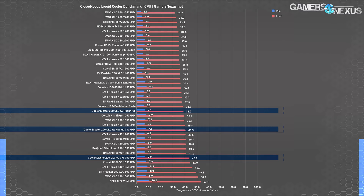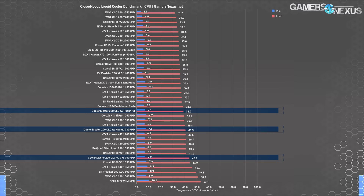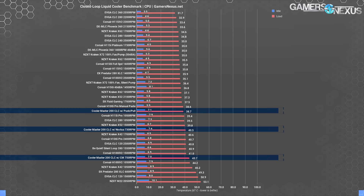As for push-pull performance, it's typically not worth running coolers in push-pull because the value dips so hard, but the Cooler Master unit ends up at around H100i Pro performance when Corsair's 240mm CLC is at full speed. Also in range of the 38.7 degree result is the Kraken X52 at full speed — another 240mm cooler at 37.3 degrees Celsius over ambient. That's not bad for the Cooler Master unit. All things considered, it's still not practical except in a few cases, specifically the H100, but it's amusingly competitive with 240mm CLCs in raw thermals.